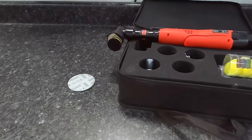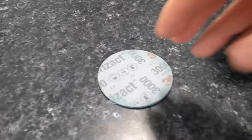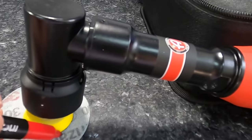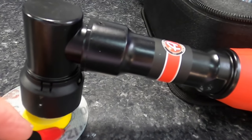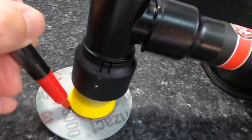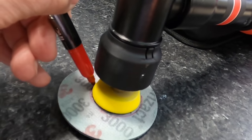Let's move on to deeper scratches through the clear coat, into the base coat, or sometimes down into the rubber, plastic, or metal. Those can only be fixed completely by sending it to a body shop. So, you can move on from just hand sanding and use machines. There are all kinds of dedicated wet sanding machines that'll even feed water while you're sanding and keep the disc or the paper clean. Or you can use a little mini micro polisher like this.